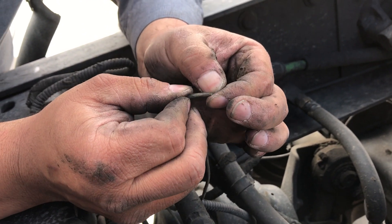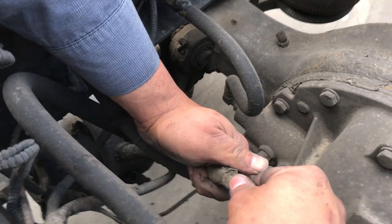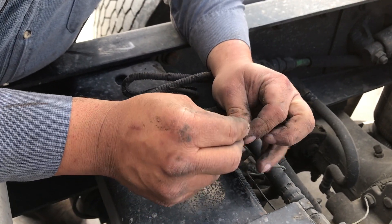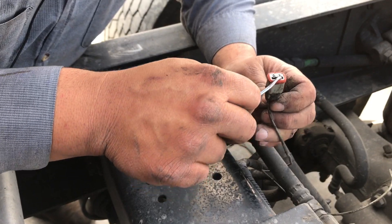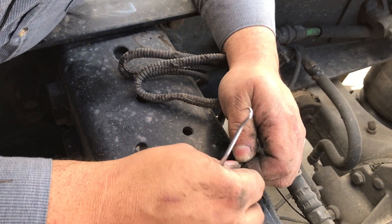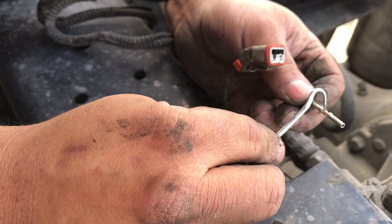This one — you can tell the insulation is fine but you can tell it's actually interrupted the actual wire material. It's even green, it's been corroded, and it's actually been open. What I do here is I actually repair it — I have the terminal to repair it. I take this lock off and pull the old terminal out. Instead of splicing, I can repair it since the actual damage is far enough away, though the corrosion is all the way up into the terminal.